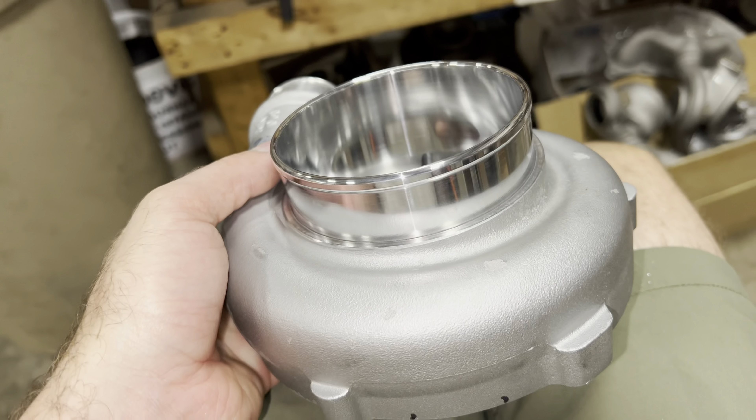Now that I have the inlet pressed in, I want to cut this out to the bare minimum — around 3.75 inches. Then I'm going to redo this: I'll put my previous dimensions here and here, note the thickness of that tab, and cut inside here for the T51R mod.